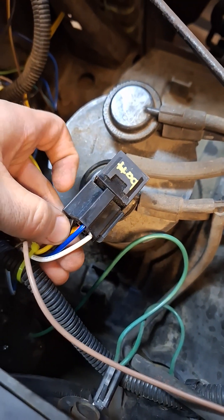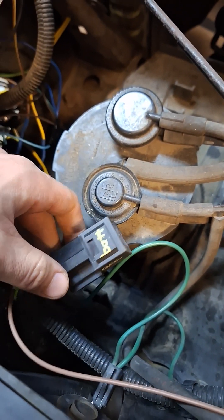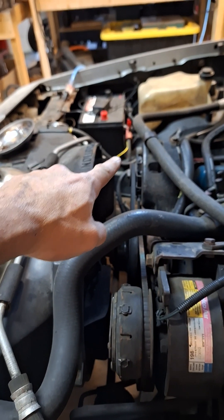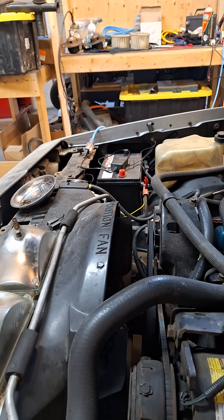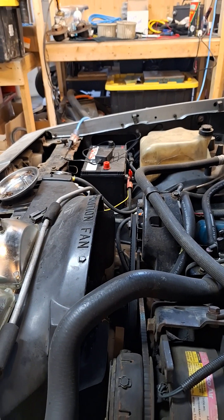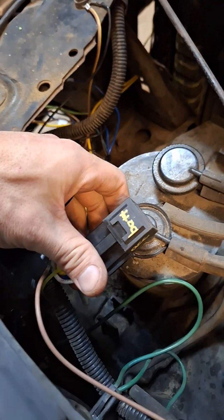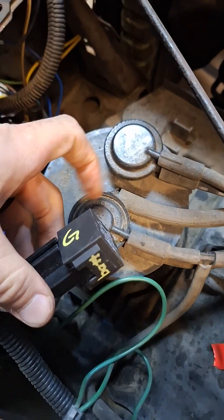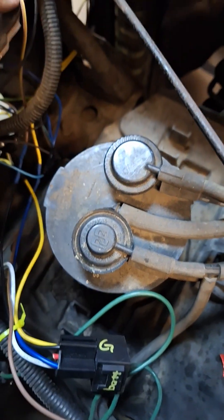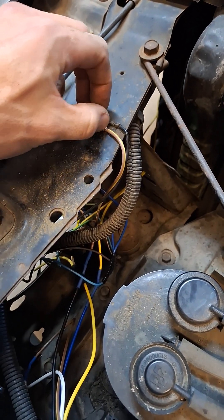Out of the relay, this blue wire ends up spliced into a wire that runs to the battery — that's the yellow cable you see connecting to the permanent positive on the battery. The black wire here is ground and connects right there to an existing ground point.